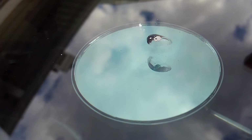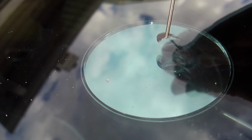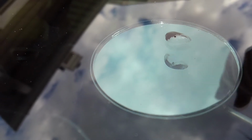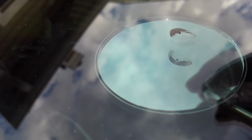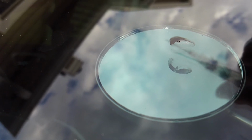Okay, as you can see, I drilled right where the rock hit, and then at this point here I have a little bit of air, and I'll blow that out, get rid of all that crushed glass, all those little fragments. That's going to allow the resin to flow in more smoothly without being obstructed by those little shards, little pieces.